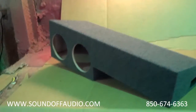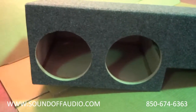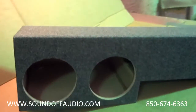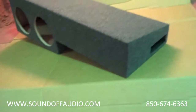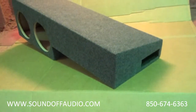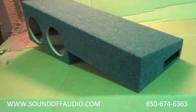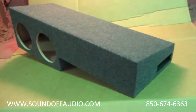This is made for two Sundown SAs, but you can put down near anything in it. Terminals on the back, vented out the side for extra port length, so it's a lot easier to get that length of port running it horizontally instead of against the direction of the cab. I'm limited to about 12 inches of port length there, so this one's about 20 inches of port length.